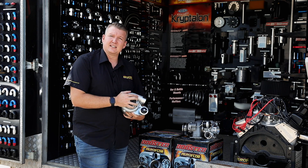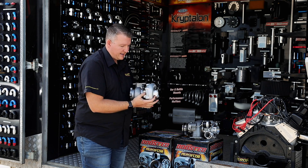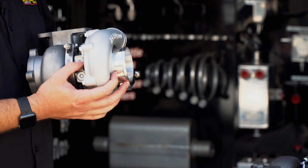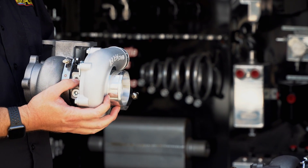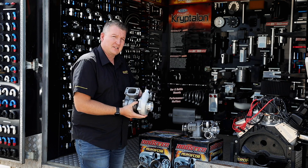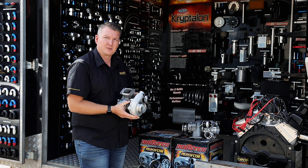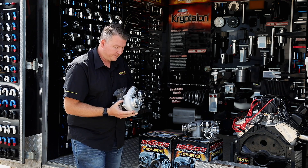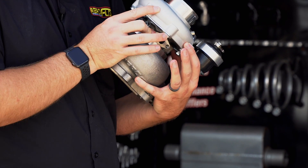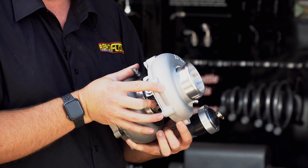These are all familiar items from the regular B5455. Moving to the core, you'll see that nice compact core design with water ports on either side — it is a water-cooled turbocharger, so make sure to use those for warranty purposes. There's a restricted feed fitting on top; if you're not using it, you need to run a 0.7 or 0.8 millimeter restrictor in the oil feed line. On the bottom, the 38 to 44 millimeter turbo drain adapter works on this turbo — that's part number 46305.